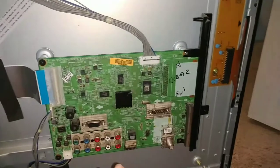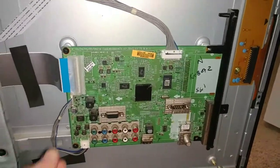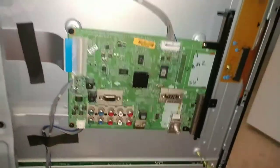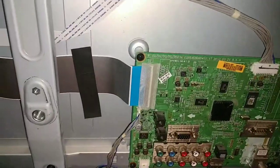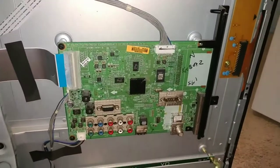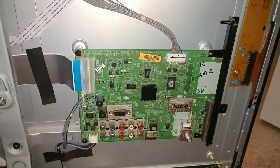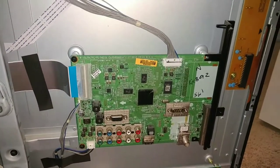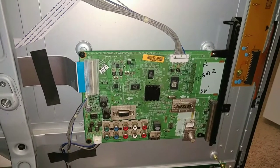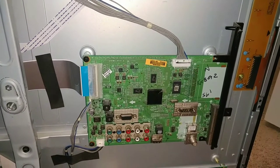So just a note — I started taking the screws out of this board here, and these two were not even finger tight. Then I started messing with these two and they were the same — all four are loose. I'm assuming that is our problem, because we're not getting a solid ground to this logic board. When you don't get a solid ground on a logic board, it screws with the logic. All the digital conversion for the audio/video — it'll mess it up, create noise, and you don't get solid ons and offs.